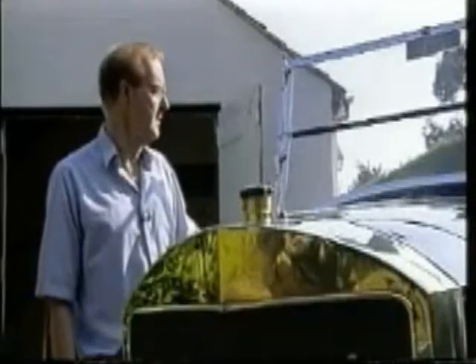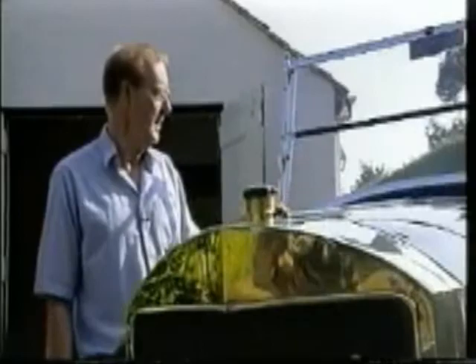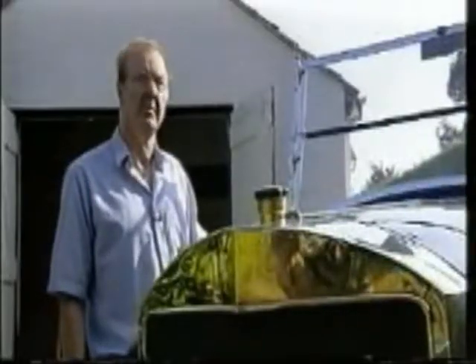I've got some pieces of steel, as you can see here, milled a slot in where the window fits in, and then a friend of mine heated these up and bent them to fit the windscreen base moulding, as you can see here. Welded all the bits together, polished them, buffed them, and then sent them away for chromium plating.